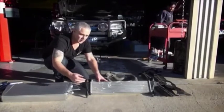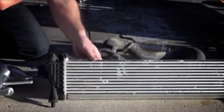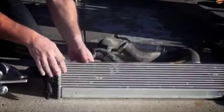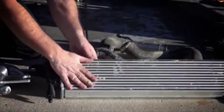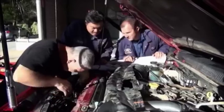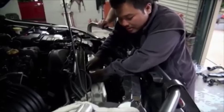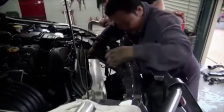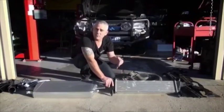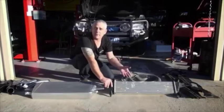So if you have an air fuel ratio of 19 to 1, which is about the optimum range for efficiency, power and torque, and then you fit a larger intercooler which cools the charge down even further, what you'll get coming out the other end will be cooler denser air and you'll actually have an air fuel ratio of 25 or 26 to 1 — a much leaner mixture. When we add more fuel, we're only adding it to bring the air fuel ratio back to the correct mixture, around 19 or 20 to 1. By doing that you're creating more power and torque, which means you can use less throttle to maintain road speed, giving you a lot better economy.